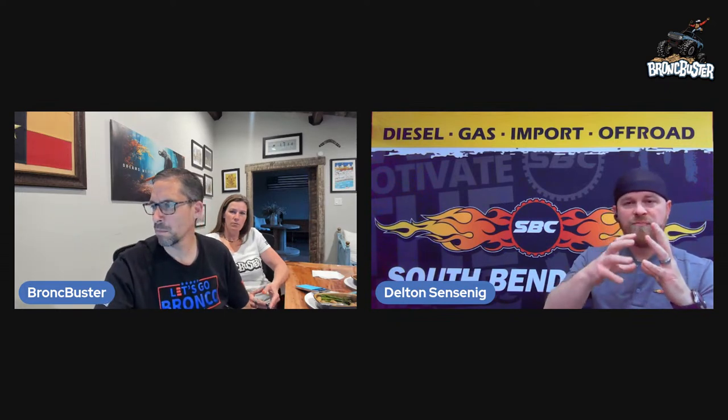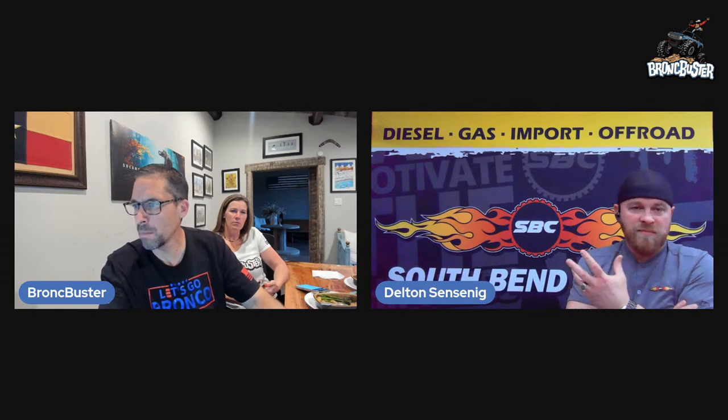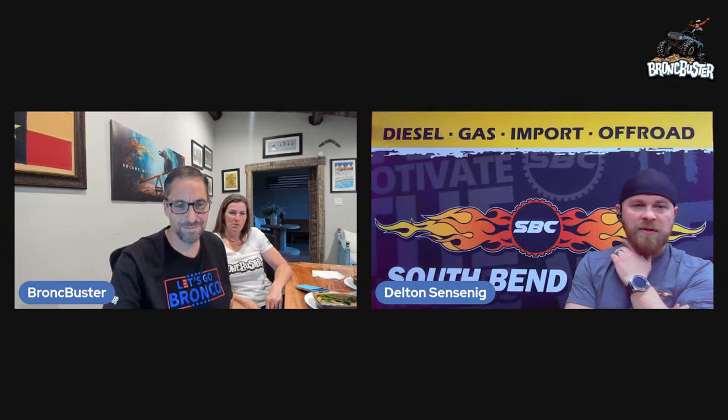The problem with dual mass flywheels is there's a lot of moving parts. So essentially you have two pieces of metal that are connected with a series of springs internally that, as it showed in your opening video, allows the flywheel to oscillate. And that causes, obviously, a lot of wearable parts and a lot of moving parts. The reason that OEs are using this is primarily due to creating a better driver experience.